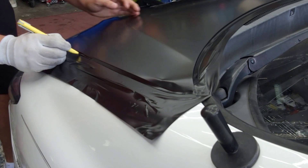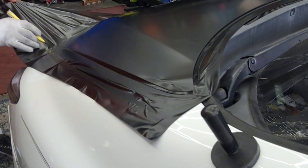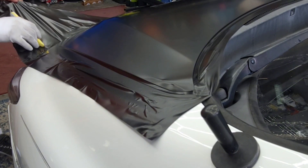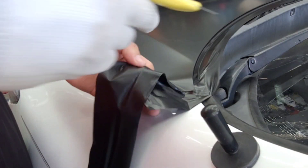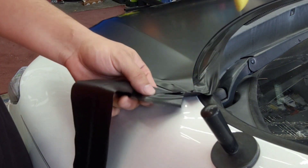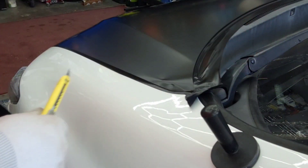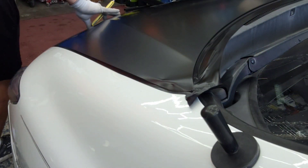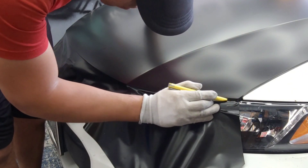When you cut, you're going to want to cut on the opposing body panel. So if you're working on the hood, you're going to want to cut on the fender side so it gives you a good gap to tuck underneath the hood. This also gives you a uniform cut so you won't have any janky cuts and it will look professional when you finish up the job. I'm leaving a bit for that corner as you can see, so we can work on it later.